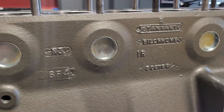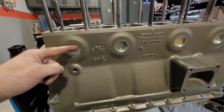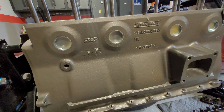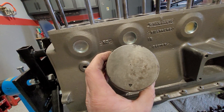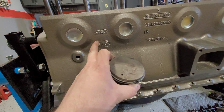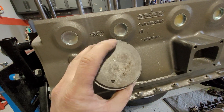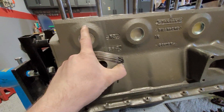So if you're doing it and you want to measure to see what size — what distance is — your top, middle, and bottom, that's how you know. Just in the event that if you've taken the piston out and they're not stamped, or they've already been changed — like this one already had them changed to a standard size. All the motor ones just say STD for standard. But if you want to know what measurements you are, that's where you'll find the stamps.